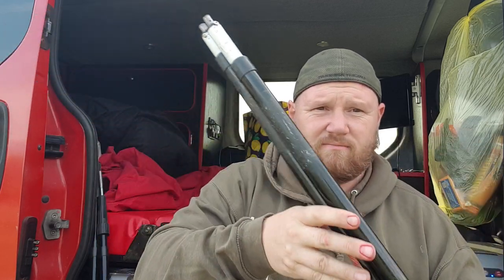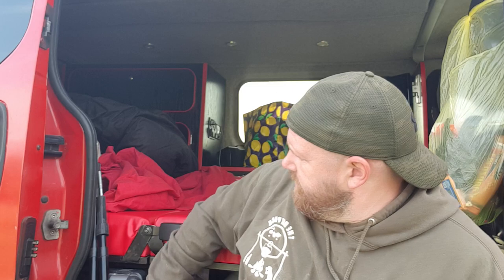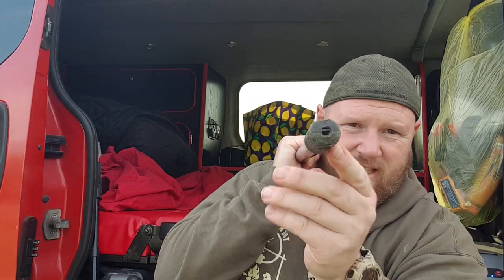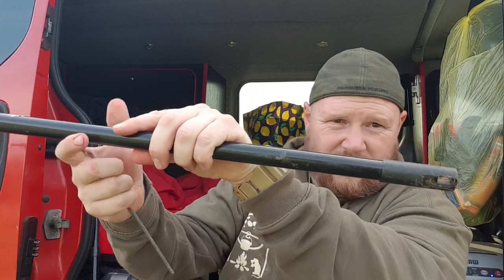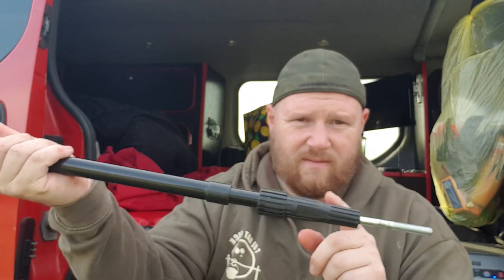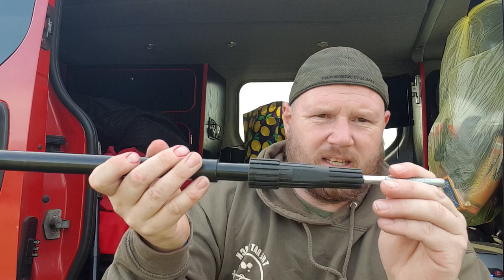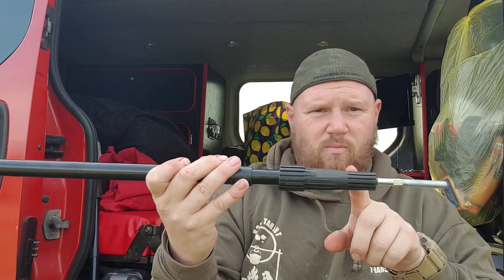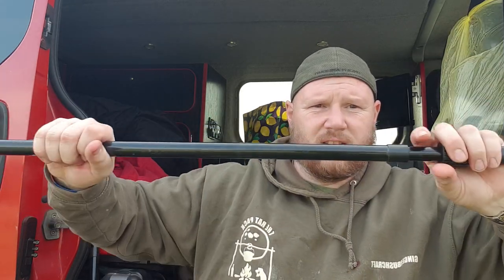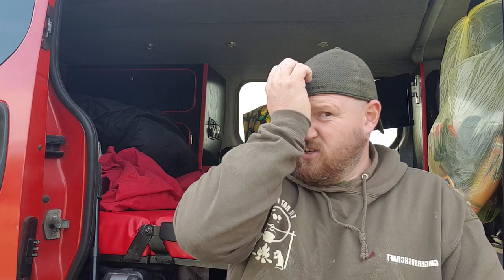You can make all four of these out of the same poles; it's just I have two of each. Your second pole — this is what I meant about the other end where you can hang it up. What I did with this one is I've put a hole in the end so that when these are on the ground you can go in through there with a diagonal stake into the ground and they're not going to lift out at all. These are called Fisher bolts — they have a screw-in thread on one end and a standard thread on the other, so it's just a bar really. That's the components — it's easy, anybody can do it, two minutes in a workshop. It is a DIY project but it's not something you need to be skilled for.